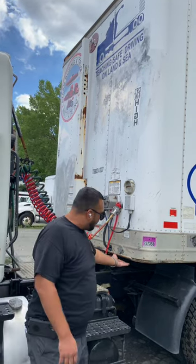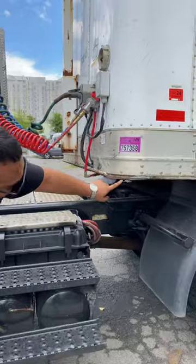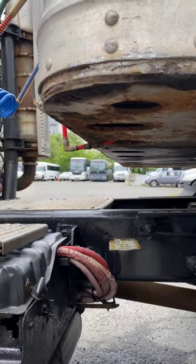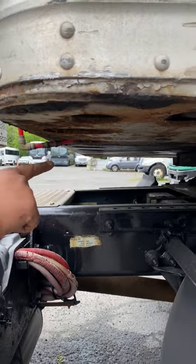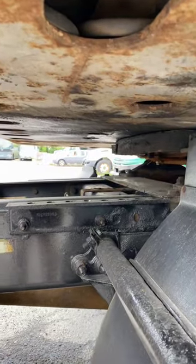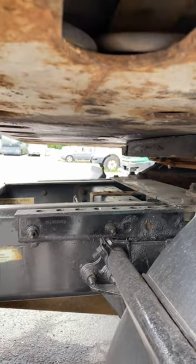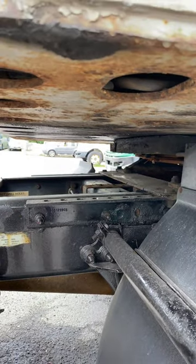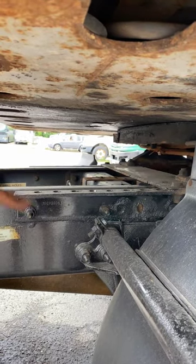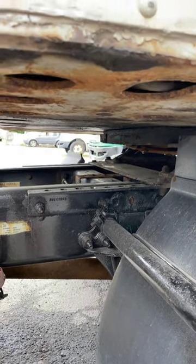From there, I would jump right to my apron. My apron is not broken, not cracked, not damaged. It is properly mounted and secure to the bottom of my trailer and there are no broken welds. There is no space and no daylight between the apron and skid plate. The skid plate has to be 100% greased. The apron has to have grease in the center. My skid plate is not broken, not cracked, not damaged, and is properly mounted and secure to my platform. All the mounting bolts are not rusted, not cracked, and none are missing.